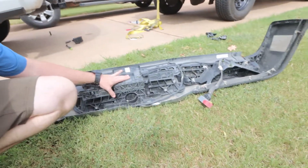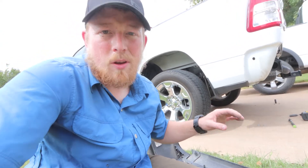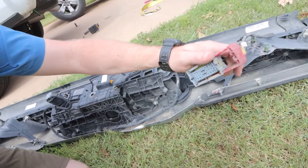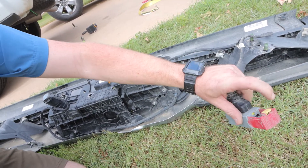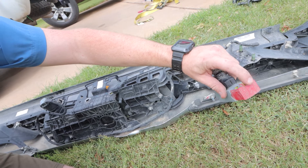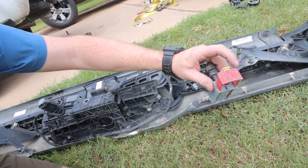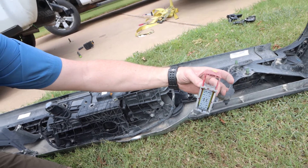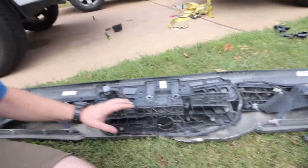And of course the wind would kick up. I've decided to take the entire bumper off — it's pretty simple, only held on by a total of six bolts and an electrical connector. The electrical connector is on the driver's side: you pull the yellow tab out away from the connector, then pull the red piece straight out. Then you've got two bolts on each side.